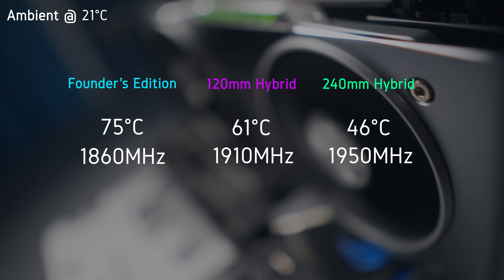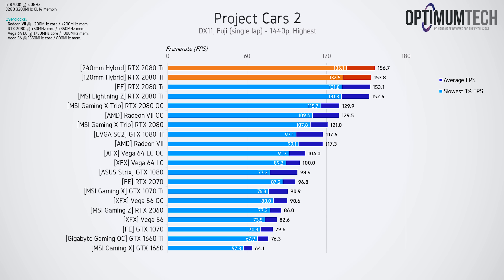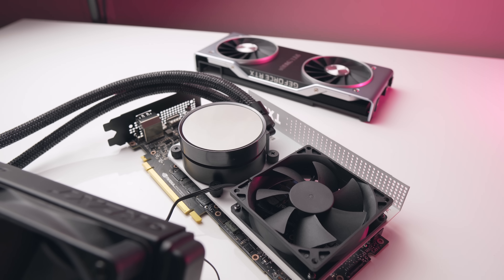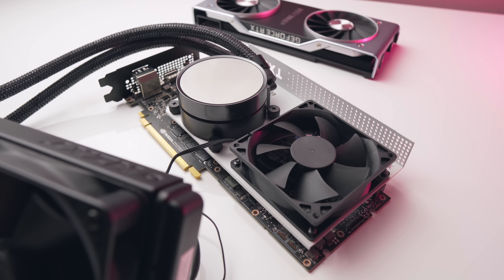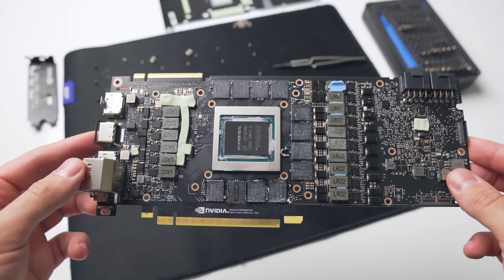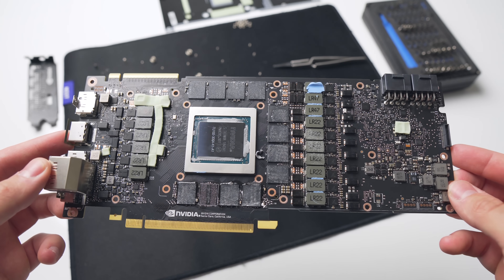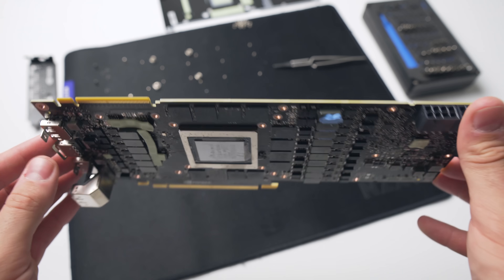That's without any adjustments to the power limit, which the card is clearly hitting. This gives us a nice little boost in-game similar to what you'd see by manually overclocking, and by running the GPU cooler we potentially acquire more overclocking headroom. In the end you're likely going to be bound by the power limit on all three configurations anyway. Now onto VRM and memory cooling — this is a big concern for a power-hungry card like the 2080 Ti. The 2080 Ti is well-equipped for that amount of power with an adequate number of phases and high quality power stages. The VRM on the Founders Edition is split across two sides of the GPU.